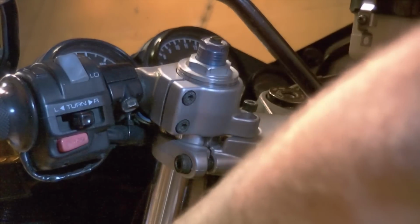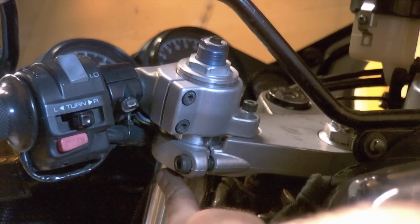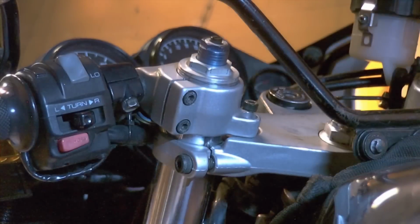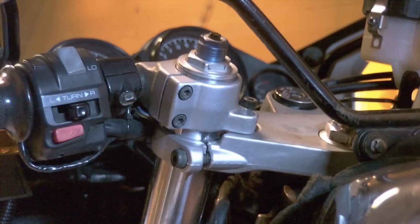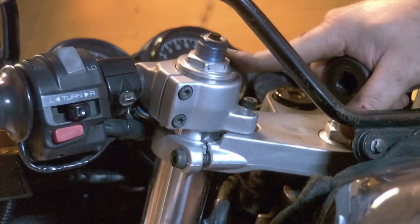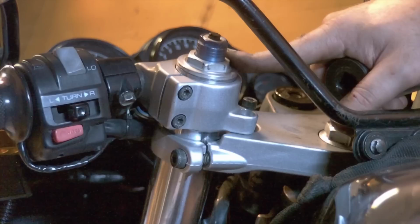The lower pinch bolt is still tight, holding the whole tube assembly into the fork from rotating. Next thing we're going to do is crack our cap ever so slightly. The cap is a 27mm. Arguably you could use an adjustable wrench to crack this loose, but it should be torqued properly when it comes to reassembly, so it would be best to have a socket for it.